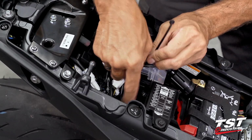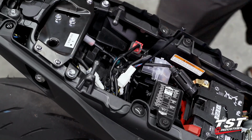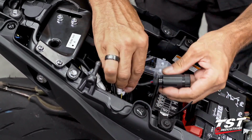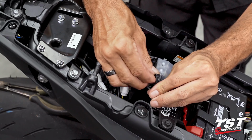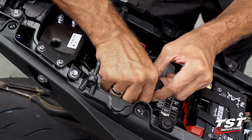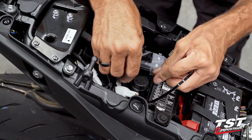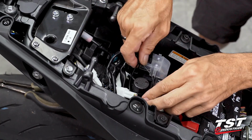I'm going to go around this harness from the bottom. Some needle nose pliers will help me in this. My sausage fingers just don't fit in there. All right, so I think if we tie off this portion of the wiring down here to that harness, and then the top to here, that'll be pretty money. We do ship these brake light modulators with 2 wire ties, so you'll have enough to make this installation just like I just did.